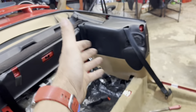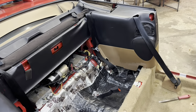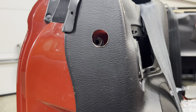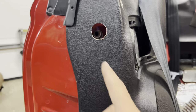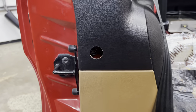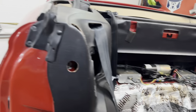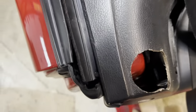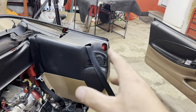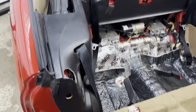Both panels are now installed — not completely fastened yet so I can move them if needed. They line up pretty good. One is slightly off — either too low or too high — but I think I'll be able to swing a bolt in there, otherwise I'll file the hole out a little. The other side matches up better. We're going to have to try it now.